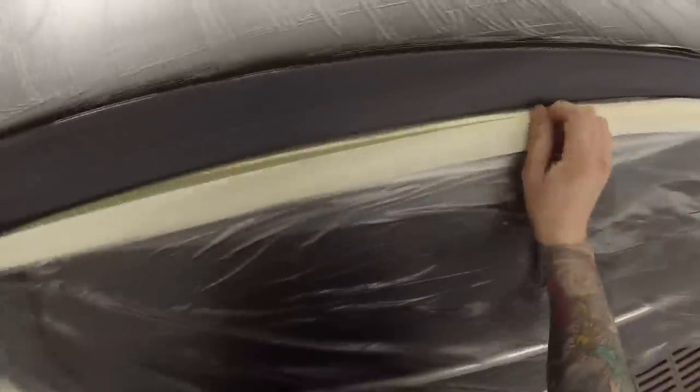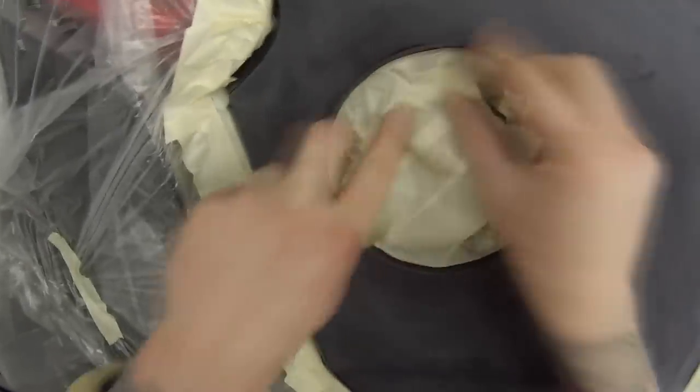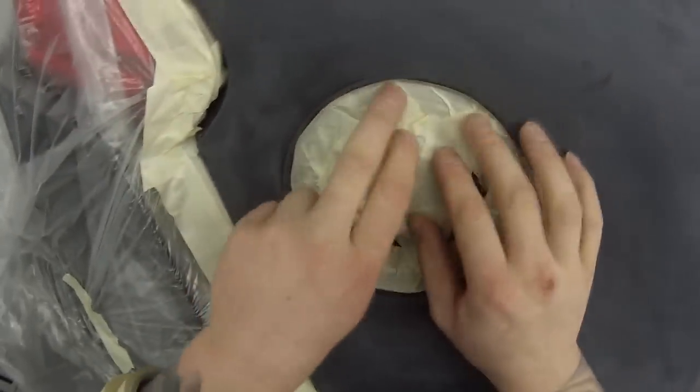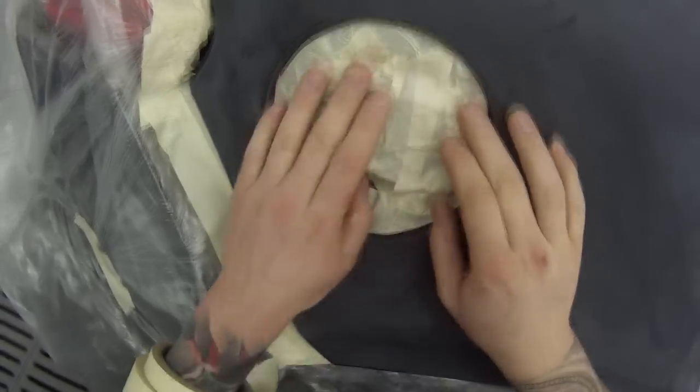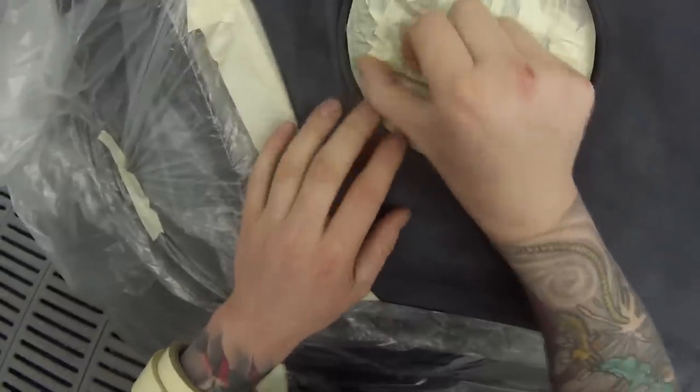Continuing around now taping that down, and I'll give you a look at how I mask up the fuel door opening. I just do my best to get the tape to stick there — it's prone to not sticking on the edge to the rubbers, so I just do my best and worst comes to worst you can scrape it off with a thumbnail later on because it's only rubber and the paint's not going to stick to the rubber.